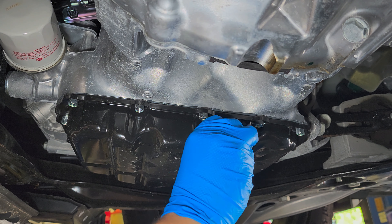Start the car and let it idle for a minute. You can also check the other fluids since you're down here. This car has 5,000 miles. After a minute, shut it down and give it a moment so the oil drops back into the oil pan. Now let's pull the dipstick.